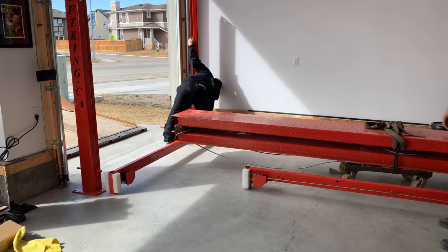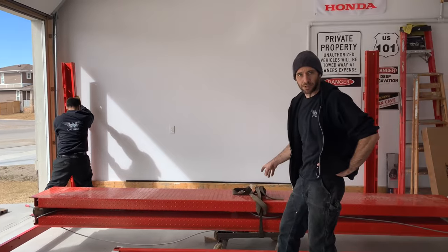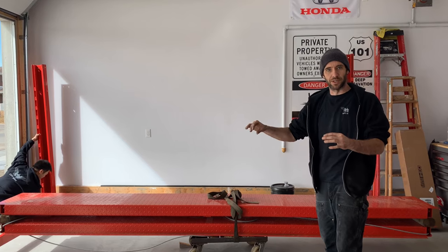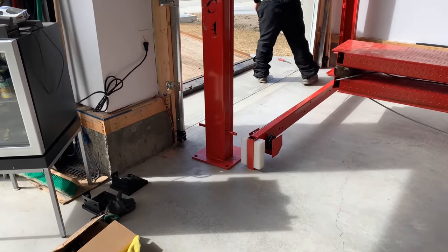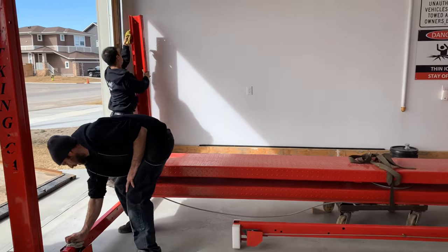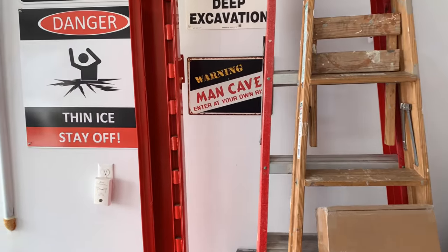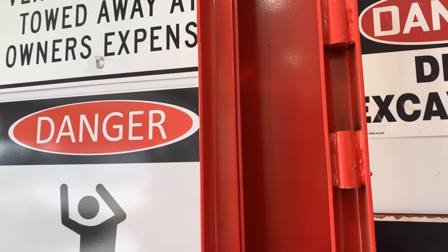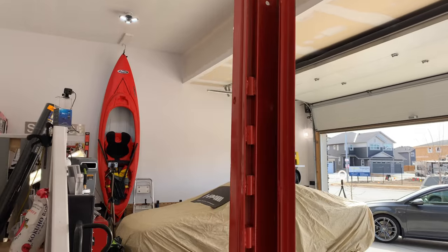I asked about the garage floor being sloped — whether we need to level it or put padding underneath. These freestanding hoists are specifically designed to be put on uneven surfaces. The key component is having the cables adjusted correctly and the platform leveled to the floor, so all the locks engage at the same time. They also have an extra wide base — 12 by 12 — compared to some competitors at 8 by 10. I also like the laser-cut lock rail instead of individual welded positions — they made improvements on the newer models.